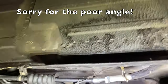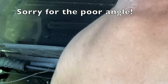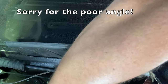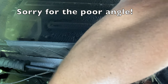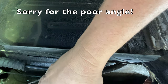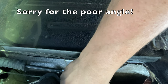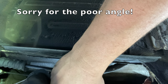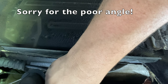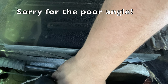Let's see if we can wrestle the alternator out. Make sure that you push that bolt to the front and catch it — I'm catching it right here with my fingers. Remember that there is a piece of tin covering the front of the alternator that may come out as well. Here's that pivot bolt, here's that piece of tin, and we're going to gently rock this alternator down. I have not undone the electrical connections at the back. I've pulled the harness down to where I am and I can set the alternator on the engine bar and undo the back cover. The harness is out — we'll pop this cover and show you what's inside.